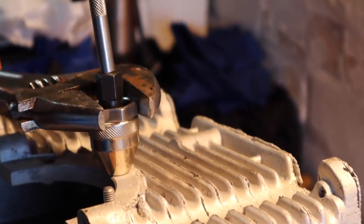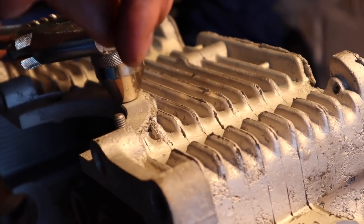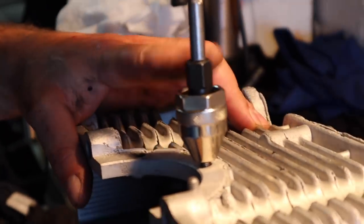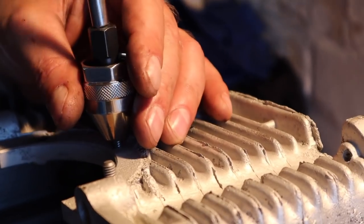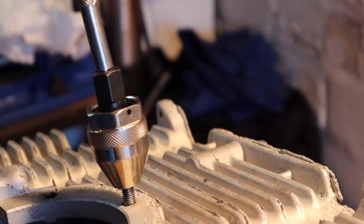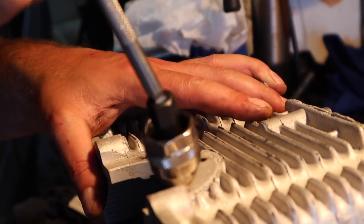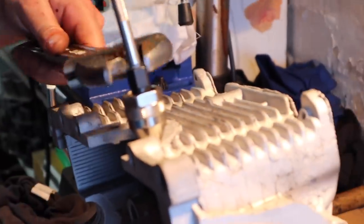Can you talk through what that thing does? It's a stud extractor. It's got a claw clamp thing and as you tighten it the clamp clamps onto the screw and you're able to extract studs. This is a small one - a quarter inch extractor. You also get three-eighths and half inch extractors so you can retrieve some significant studs with them. The studs on the new engine are missing so despite having thrown the old one out, thankfully the scrap man hasn't picked it up yet. We're at least a meter away - we're wearing our protective gear. Yeah, these invisible German flip-flop protective gear.